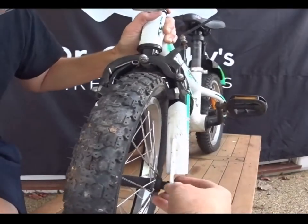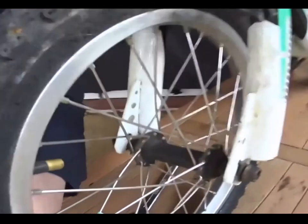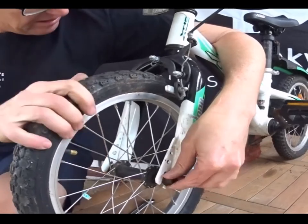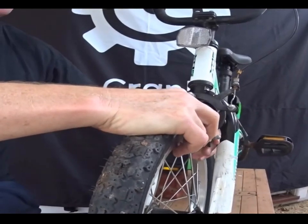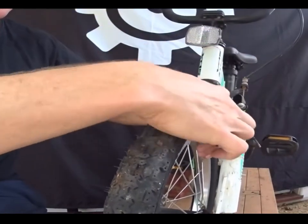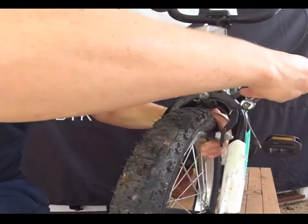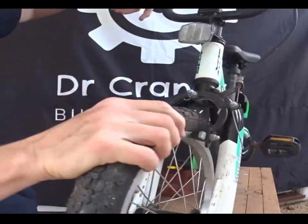When we get it in, get it straight in the forks. Put these safety washers around so that tab sits into the hole in the fork. Then up here, hold the brakes in, pull that through — the housing needs to be seated properly. Get it back to where it was and tighten that back up. Tighten that up. Check the brakes — sitting on the rim. That's tight.